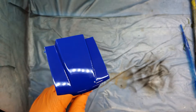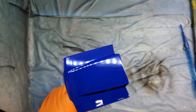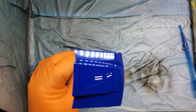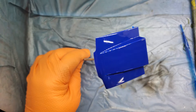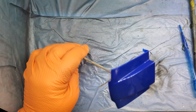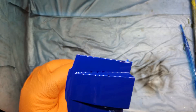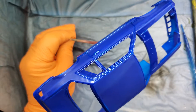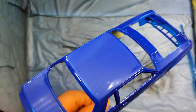I don't like to leave these set for long because it just gives more chance for dirt and dust to be drawn into it. I'd like to keep right on it, but obviously you can't just keep baking it on there either. It's looking really nice. If you do get any little specs in there — this is gloss blue paint — it will polish really nice so we can actually polish those out easily once it cures. We'll give a couple more coats and call this good. I see a light spot right there, so I'm going to give it a little heavier coat this time. That looks pretty good. I'm going to bring the hood back in one more time, let it sit and cure just for a bit, and then give it a nice heavy wet coat.